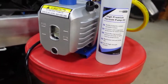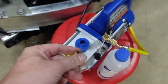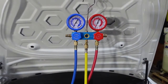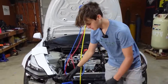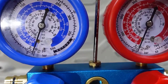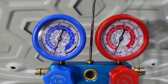If you get a new vacuum pump, you want to make sure you put oil in it first. Vivo Home sends the correct oil — just make sure you have it between the minimum and maximum. Add it through here. And this is actually the exhaust, so we're going to take that off — I just keep it for storage so dirt doesn't get in there. So now we can turn the vacuum on, watch the gauges, and make sure it pulls a vacuum. Then give it 45 minutes. Both of the gauges are at zero — I'm going to turn on the pump, and then you should see both of the needles go to the vacuum. Both are pulling vacuums perfectly — this one's at minus 30 inches of mercury. Now we're going to set a timer for 45 minutes, and we'll come back, turn it off, and let it sit to make sure we don't have a leak.